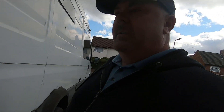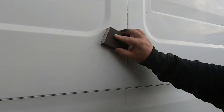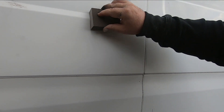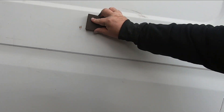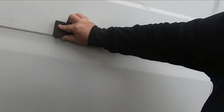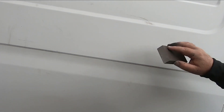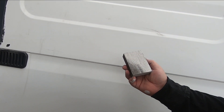This is where it all starts — the first thing you've got to do is make it all dull, get the scratches on there, get a key. Get in them curves — it actually doesn't take long. That's done, that's ready for paint. When you've done it, you clean it with some panel wipes because there's a lot of dust. After you've cleaned it with panel wipes, that's ready for paint.